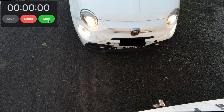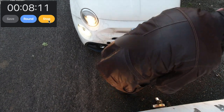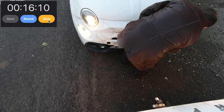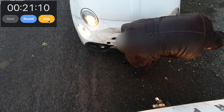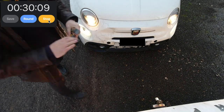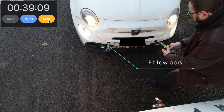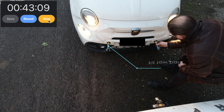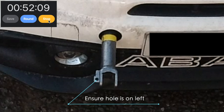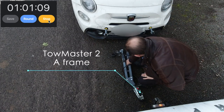In a video to follow we'll share our experiences of towing with it. So the first move is to remove your tow ball cover and remove the plastic caps which cover the holes in the bumper, made as part of the install. These are black caps, but we now have colour-coded caps that were included with the kit but unavailable on the day. Once they're removed, you've got these really heavy pins that you push in and do a quarter turn to lock into position. Then go fetch your actual towing frame - this lives in a nice little leatherette bag in the boot.